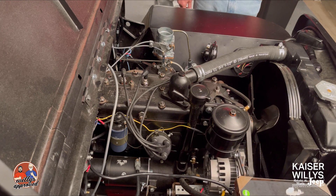We'll show you how that functions when we actually start the vehicle and get things running. One thing to note: you might want to put a little bit of grease down into the inner cable so you can pull it in and out a bit better. That's how you run your choke and throttle cables through the dash. We've got these in olive drab and black — hope this helps, thanks for watching.